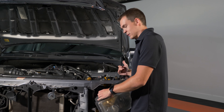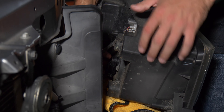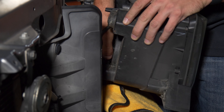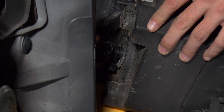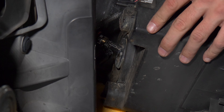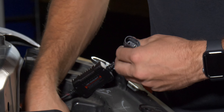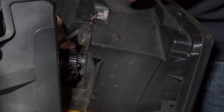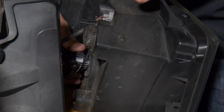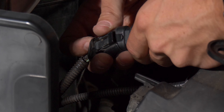I love working on these Toyota Tundras because this is it — that's all you've got to do. The high beam is right down here. Press in on the little tab, remove the connector, twist the bulb counterclockwise, and pop it out. Grab the SV4 high beam bulb — it's the 9005 size. Twist it into place. This thing fits awesome, it's not going to wiggle out. Go ahead and connect the driver to the factory wiring.